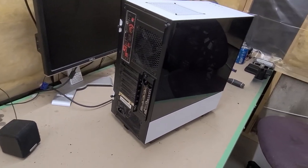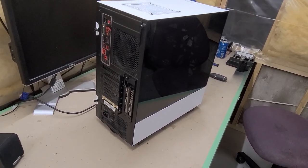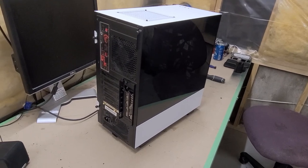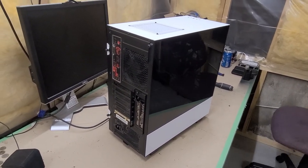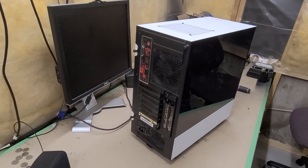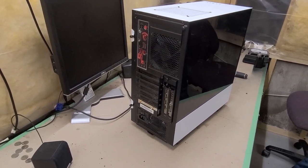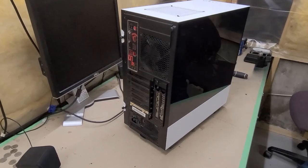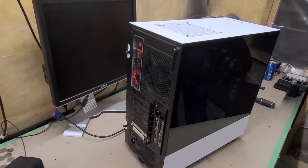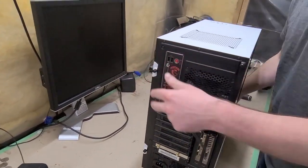We're going to power it up. The solid state drive needs to be wiped since it's new to this house and we don't want an unknown OS on it. We'll switch out to a 1080p monitor since this is a 1080p gaming machine. We'll also check that the riser cable on the vertically-mounted video card is okay — I didn't love the bend we put in it, but it should be fine.